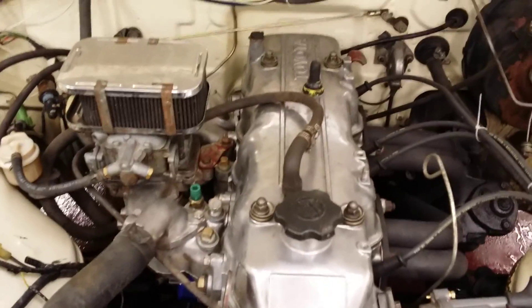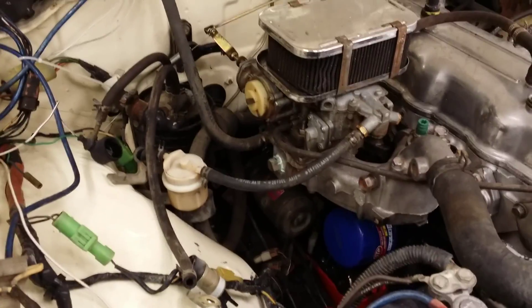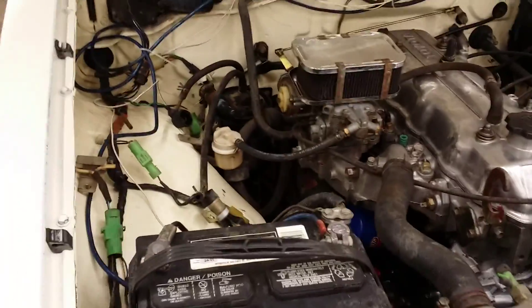She's got a new heart. It's kind of a longer video for a change, but I had to go through a lot of stuff. I wish I could have filmed it but I was in a hurry — I only had a couple days to get it in, since I'm using this truck as a daily driver. I've got a lot more to do; today I was able to drive it and tune it a little bit, but I can only tune it so much because I need to get that carburetor off and cleaned up. They say you have to run a regulator on these Webers — I don't have one on here and it's running great, but I've got a feeling I'm on borrowed time, so I'm going to throw that on there.